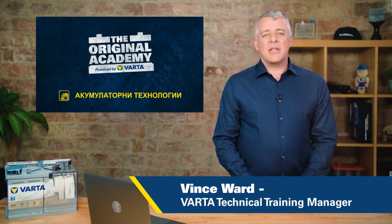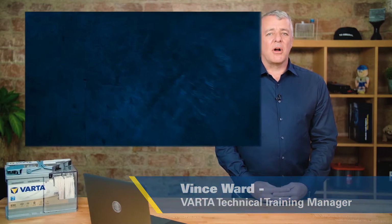So let's discuss the different technologies of batteries that are on the market now. We're talking about lead-acid batteries, so let's spend a few moments to talk about both components. Starting with the acid, the electrolyte is made of dilute sulfuric acid, and that's it. When talking about lead, we're actually talking about the lead alloy used to produce the grids.